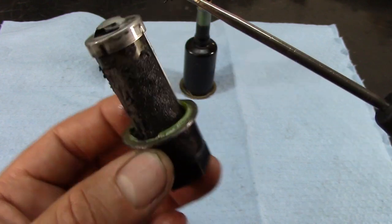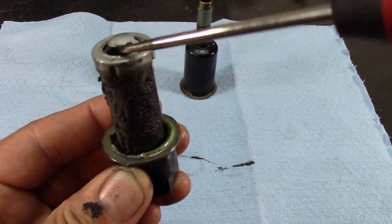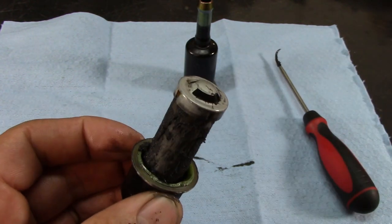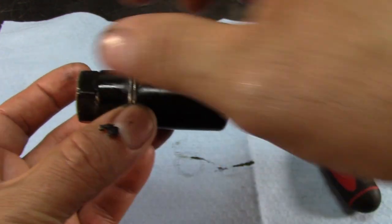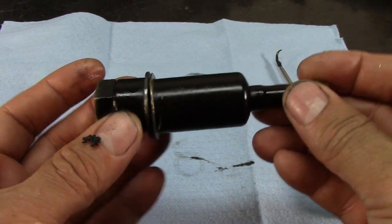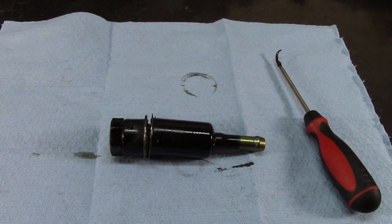You can see the little circles right here that you saw on the inside. It has a little check valve, and you can actually push it down — it has a spring in there in case it gets restricted. But it's best to just get rid of this filter. You can run a hose without the filter, but I would recommend installing an aftermarket inline filter — just pay attention to the flow and install it properly.